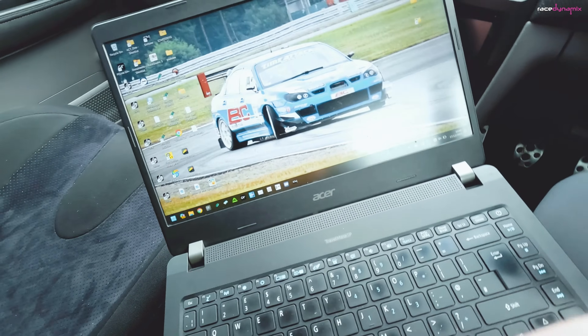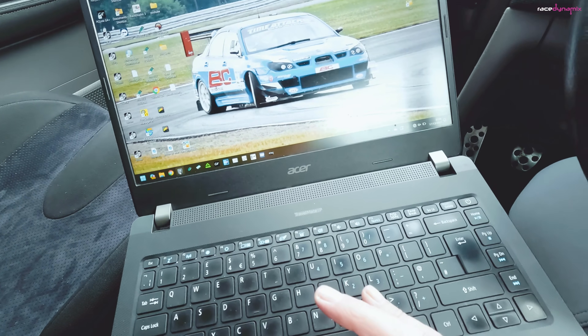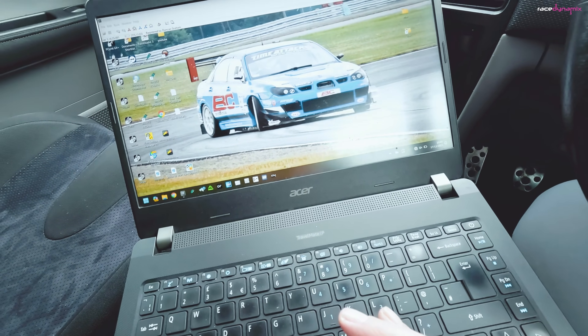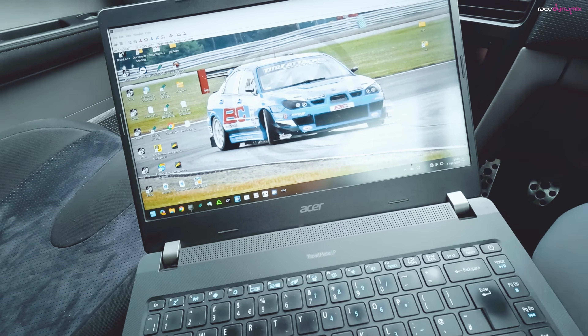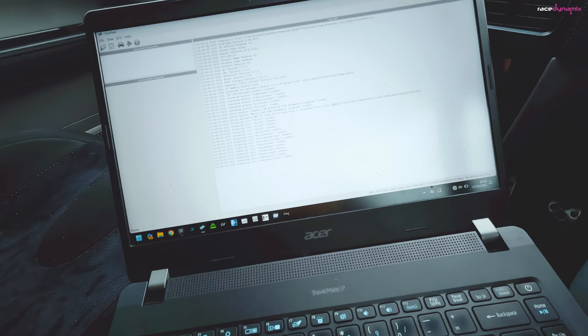It's small enough to put on my lap while mapping on the dyno, or on the passenger seat when I'm out on the road. It's pretty simple, pretty basic spec. I've loaded it with ECU Edit software, which is the main one I use, and also ECU Flash — I'll put links for both in the description. It doesn't need to be superb spec, but it needs to be reliable. You don't want it crashing halfway through writing to your ECU, because that will kill the ECU. Make sure to switch off auto updates — doing an update while writing to an ECU could also kill it.